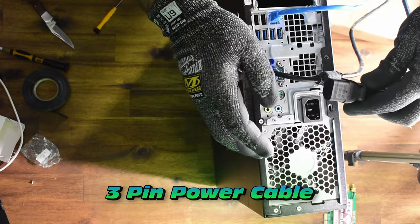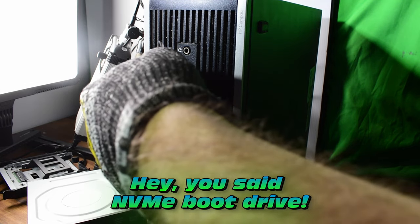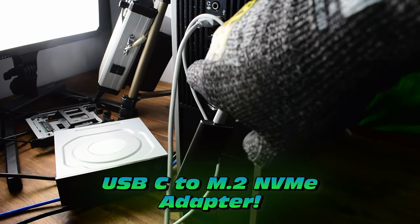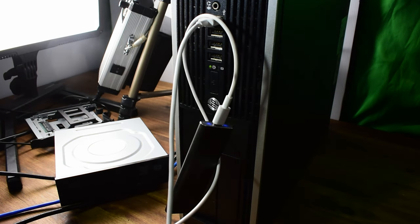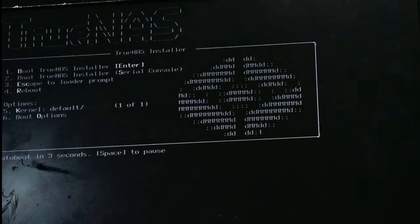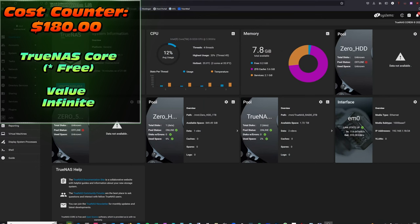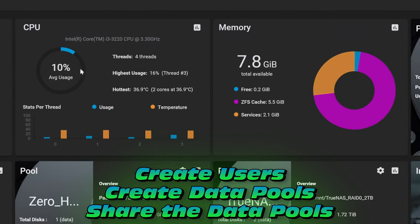Connecting the VGA cable — it's a little older but has integrated graphics, which should be fine. Booting from an NVMe — note that this particular system is too old to natively boot from an NVMe over PCIe, so we're running the NVMe through USB to TrueNAS. After fixing the RAM slot issue, TrueNAS booted up. We have 8 GB of RAM and an i3 third-gen at 3.3 GHz.